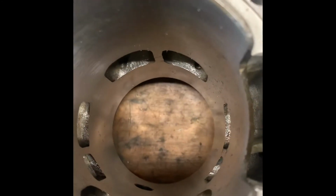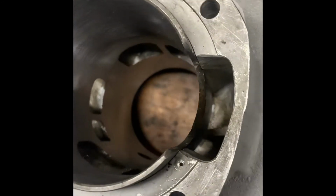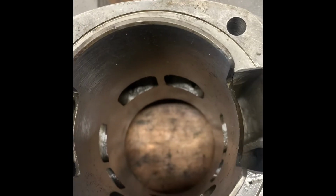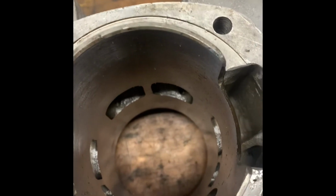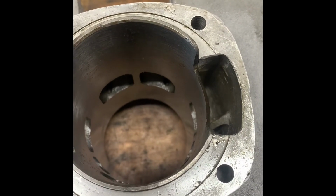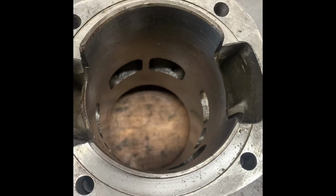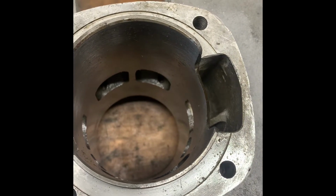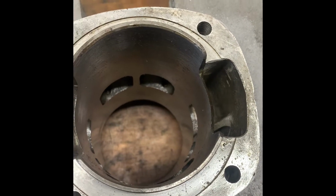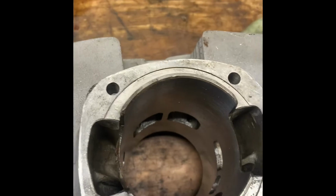There we go. So I don't know if you remember this, but there was a massive gouge down one side of the barrel and then a smaller gouge down the other side. I'd originally thought it was the circlip that had come out, but it was actually the gudgeon pin, because there must have been no circlips in the piston to hold it. I don't know who built this engine in the first place. And then the magnet for the stator had no bolt to hold it, so the timing could have gone off at any point. So a bit of a disaster, really.